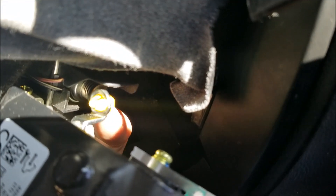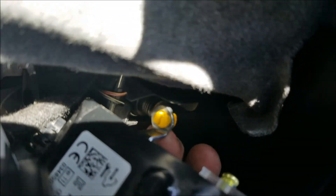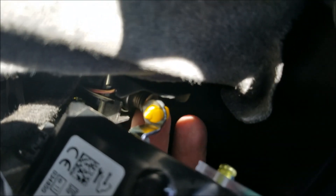What I've found is there's a plunger back here that when you turn the key it releases. The little gizmo with the yellow cap on it — it has a rod and a plunger back behind it, or maybe you'd call it some kind of a servo. When I turn the key on, it goes down, so it's locking the key into place. Now when I turn it back, it doesn't always release back because the spring behind it is real flimsy.